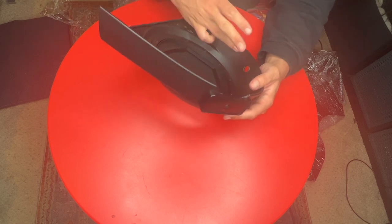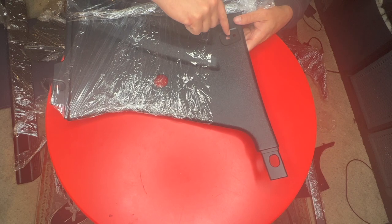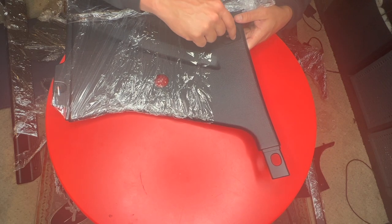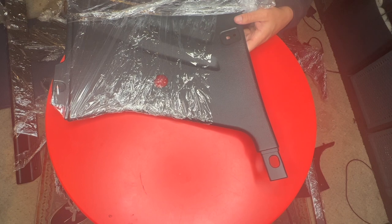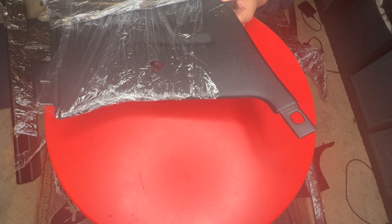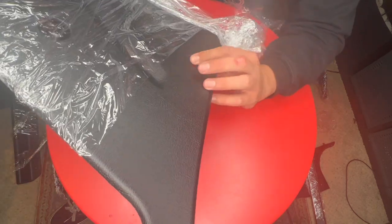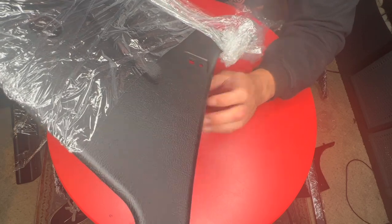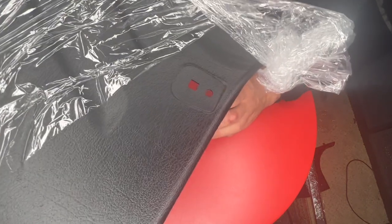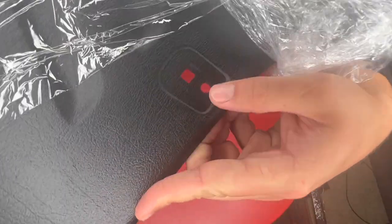You could give those smooth parts a light scuffing to help adhesion, but that's up to you. Lastly, we have the medium density interior parts — things like the A and B pillars, the door steps, the little rear plastic trunk trim pieces. This is the most common type of plastic in the FC RX7. They hold the paint well, but with enough force the paint will get scratched off — not as easily as the flimsy plastics, but not as durable as the harder plastics. Every car is going to have different types of plastics, so your results will vary.